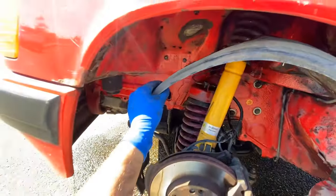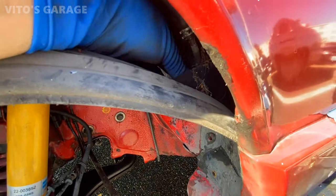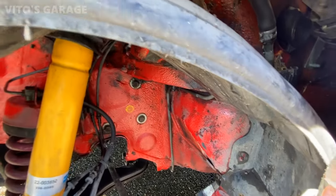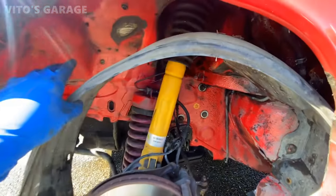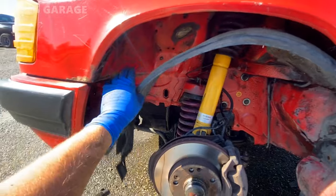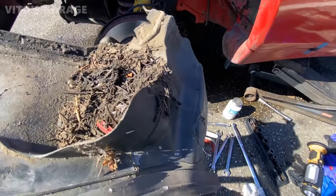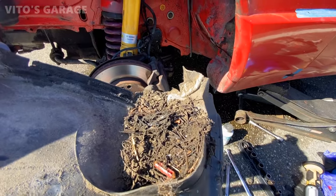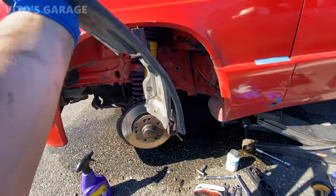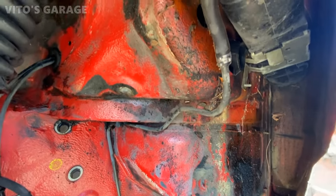I started peeling this fender liner and right over there there's actually a bunch of debris and trash — look at this, a lot of trash just stuck in there. It's really important to pull your front fenders and clean everything up and preserve it so the car can last another 100 years. Look how much trash there is here, and obviously it's gonna be hard for the water to drain. There's also a fuse that somebody dropped there probably 20 years ago. This is all gonna get cleaned up and preserved — this is our vapor canister for the evap.